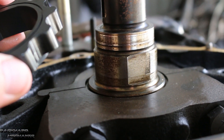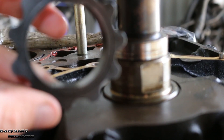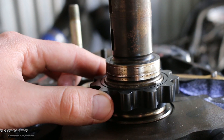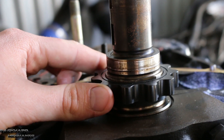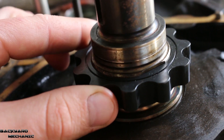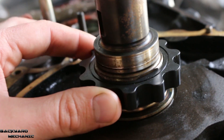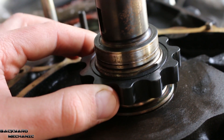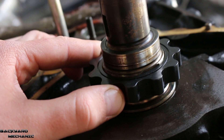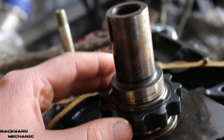This is the driving surface on the crankshaft — the flat bit — and you can see the corresponding bit on the driving gear. So we're going to slide this over, and that's what it's going to look like. Then you have your driven gear and obviously your oil pump housing over the top. There's a little bit of play there, but that's normal. The crankshaft is turning, that surface is connected onto this and it has to turn with it — that's how we get that suction and pressure difference, and that's how your oil pump works when relating to the crankshaft.